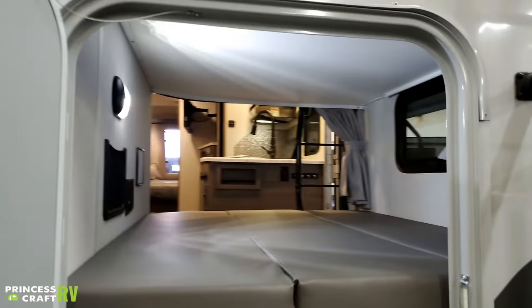A couple of switches here — sink lights and soffit lights. We have the TV here. Pay attention to this ribbon — that's going to be how you unlock it; this is in the unlocked position. Also, we have your antenna booster here. That corresponds with the RG6 cable fittings we saw on the outside of the camper — this is where those transition. If we're using a park cable service, this little green light needs to be in the off position. If we're using the King Jack antenna to bring in digital over-the-air programming, that green light needs to be on to power the antenna.